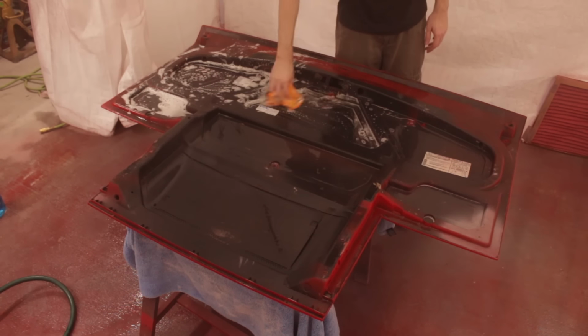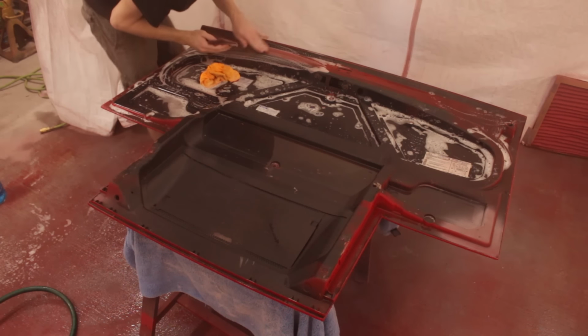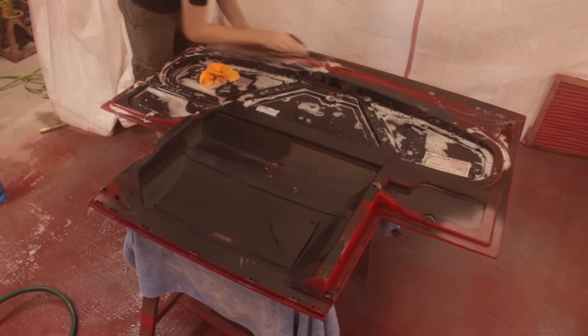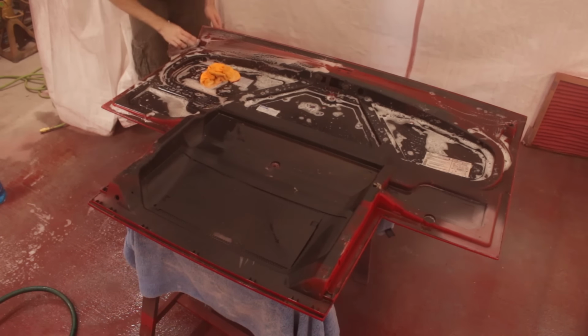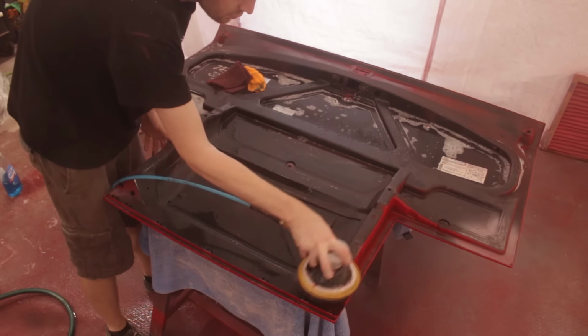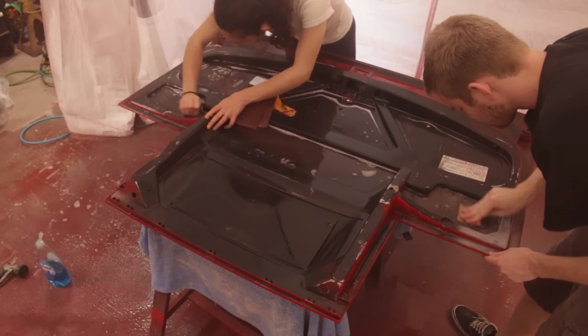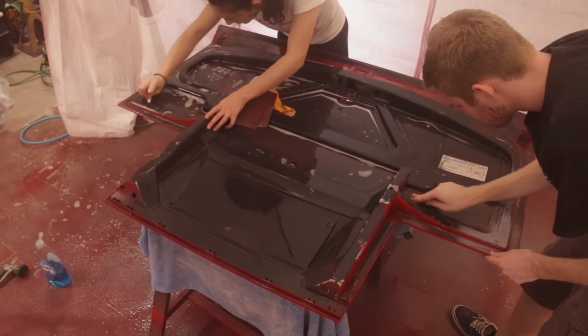Starting off with dish soap, water, and maroon scuff pads, the surface was both degreased and prepped at the same time. Wanting to speed things up a tiny bit, I pulled out the pneumatic sander and gave a quick buzz over the large flat surfaces. The smaller nooks and crannies still had to be hit, so more sanding and scuffing happened there.